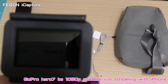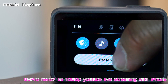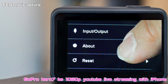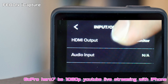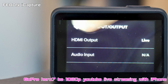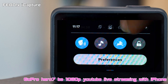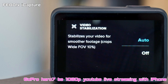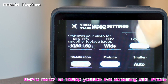You need to set up something in the GoPro OSD. Select video input output selection. And select HDMI output — select Live. Then go to the menu and disable the stabilization. HyperSmooth — please close it, turn it off. HyperSmooth off.